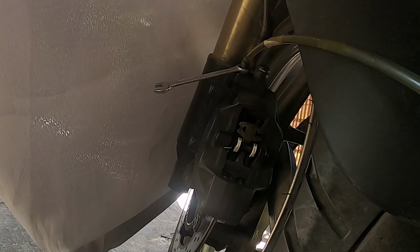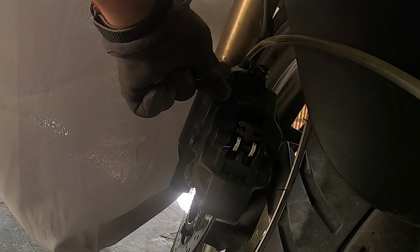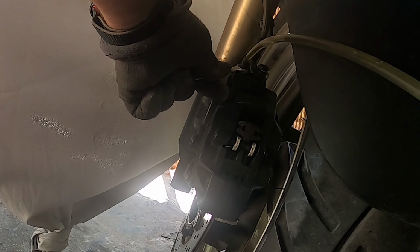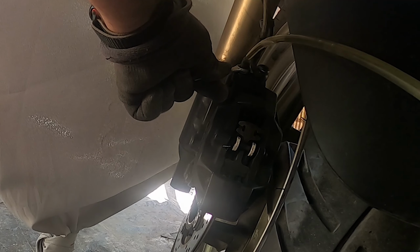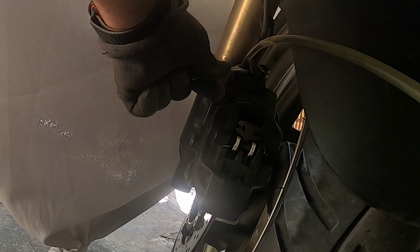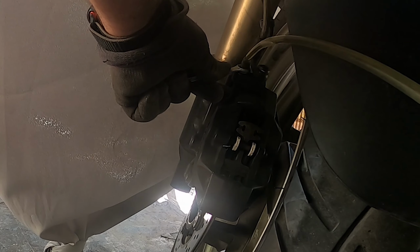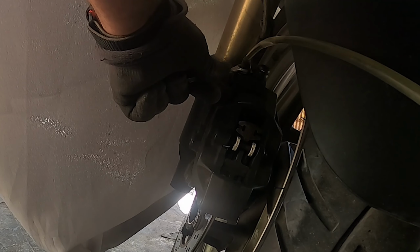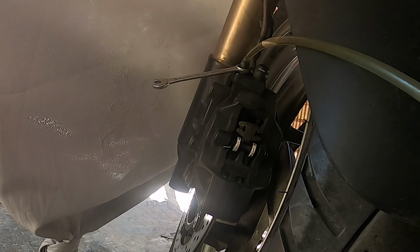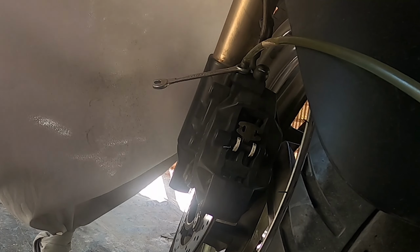I have to check the brake fluid now. It's still good. Little bit. You see, I don't open all the way. That's the trick. Before the brake lever goes all the way to the end, 1 inch before the end I stop and keep it pressed. That's what makes a difference on this. I have done this many times with all my bikes, and it works good. And you save the service. The service on a Beamer is about $400, so it's not cheap. $450 for everything you see here, or maybe more including the axle.